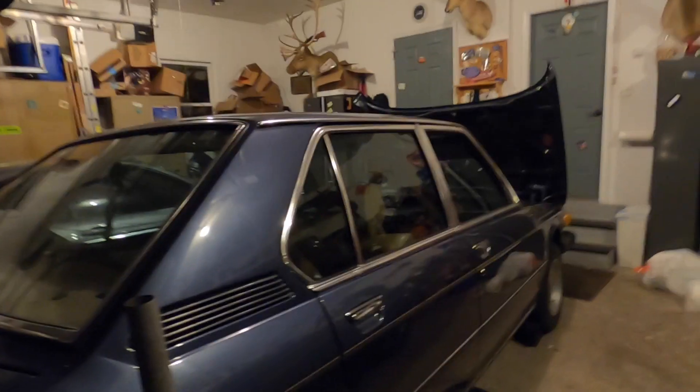That concludes it for the night. I blew it out, put a little bit of isopropyl in there, put a little bit of gasoline in there, and kept blowing it out. It's still a little damp so I hooked up a fan blowing through it for ventilation. I might pour some gas in it to let it sit, since gasoline will be better than moisture. The tank came out really well. Tomorrow I'll shove it back in, and once I get my new fuel pump and filter we'll give it a test crank and see if the issue is fixed — fingers crossed.